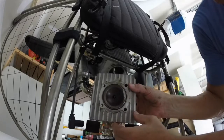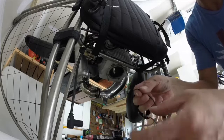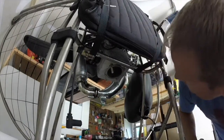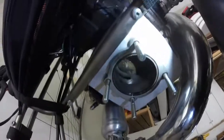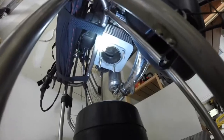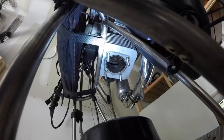At the bottom of this you can see the spark plug head right there, so I'll need to clean that out. I'm going to put this seal back in — it might not need to be replaced. Let me try to give you guys a good look underneath here. There is a good look at the decompression port that needs to be cleaned. I'll point to it with the tool right there — I need to get in there with a drill bit and clean it out.